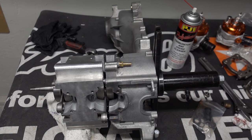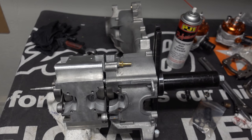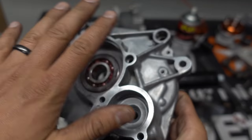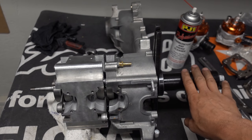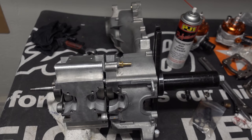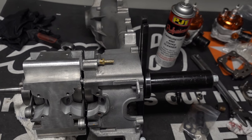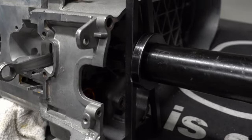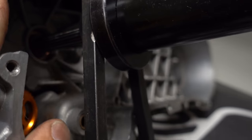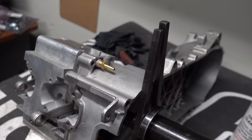Both cases have been Honda bonded on both sides and the bearings are pressed in with assembly lube on the surfaces. Make sure to re-clean every time you do this step. The Tusk crank puller tool is what I'm using here — you can find it on different websites. I've got two bars that disperse the stress of pulling the crank in on the sides of the cases rather than putting any weird force on the inside.